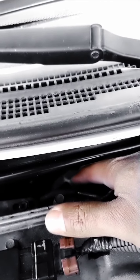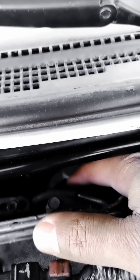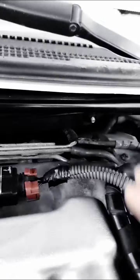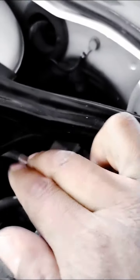You can see that little circular thing right there - that's the EGR valve. It's either clogged with carbon or something like that. And that also means these metal recirculation lines right here could have something clogging or restricting them.